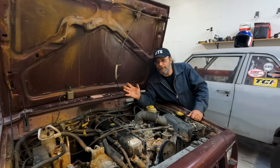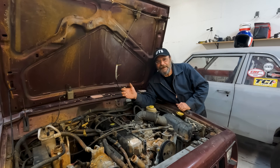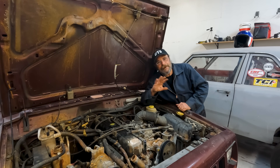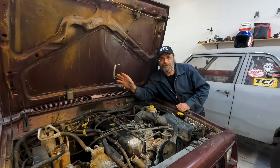This was in the fall when it really started to get bad — it was obviously a head gasket issue. It would run for a short period before pushing coolant out of the radiator, putting water out the exhaust, and getting occasional misfires — all the telltale signs. So I said, let's try some miracle head gasket in a can. I know you can't fix the problem with something like Blue Devil, but you can buy yourself a little time, and I've done that in the past.